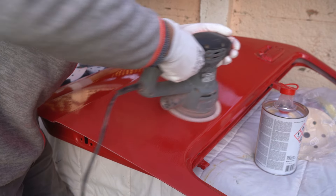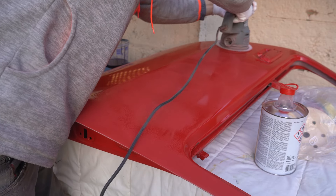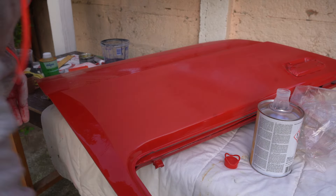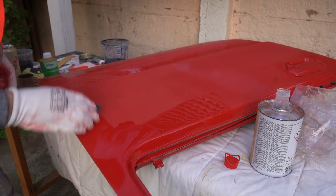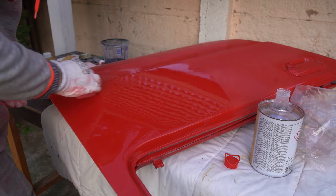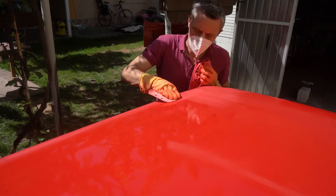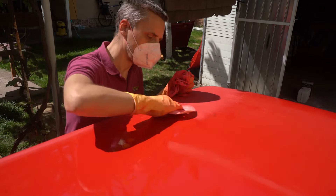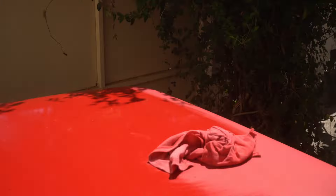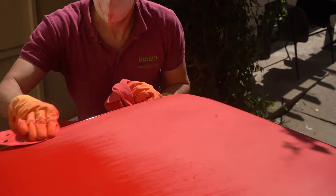Sanding with 800 grit is making the surface perfect for the next and final layer. This one looks pretty decent to me, but another layer will come to cover the scratches. I'm doing the same for the entire surface of the car — very labor-intensive job. I guess the sanding part took me like 10 hours for the complete car.